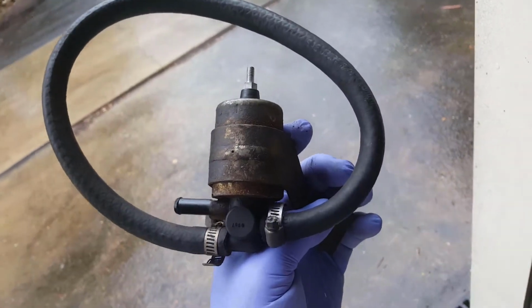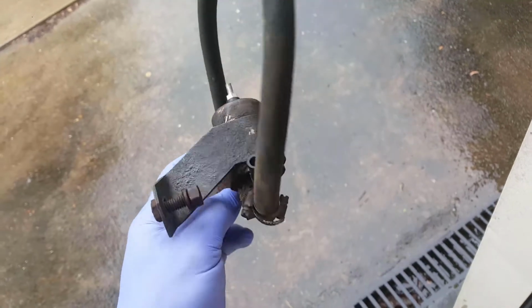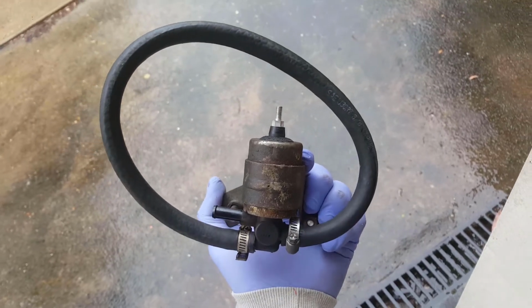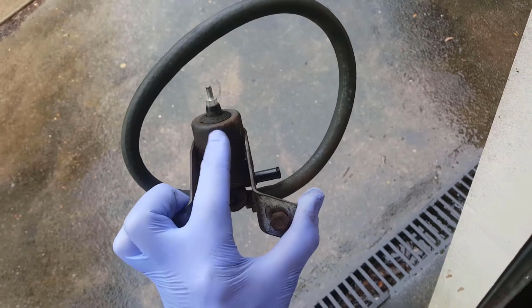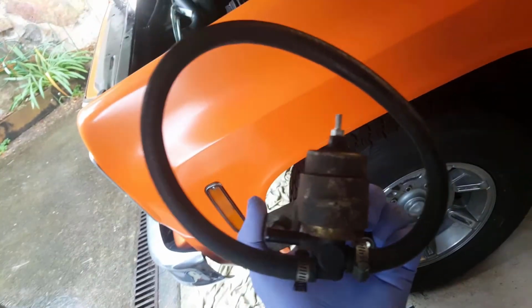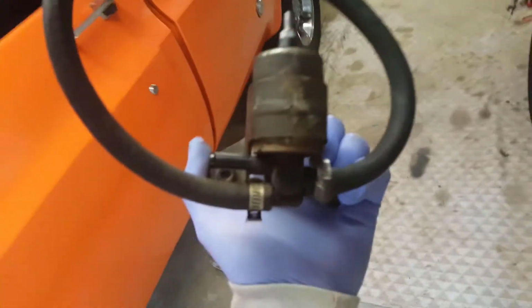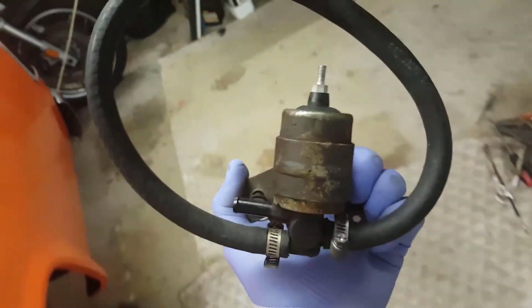That's the fuel tank switch. Just get 12 volts going to the end of it there. This is grounded when you attach it to the frame. That's how it was, so it was out of use. But it does work. I thought it was working. When I was driving it, I'd switch over to the other side and it'd give a reading like the fuel tank was working, or the fuel switch was working, or I should say that both tanks were working. But either somebody's fiddled with it, or that's the way it was, and I just misread it.